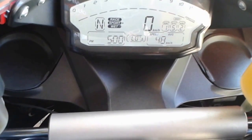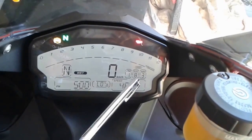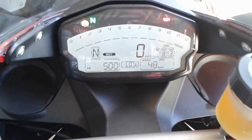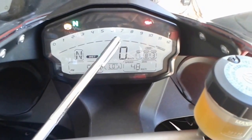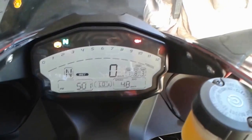We're using this button to select a different mode. Let's go into wet mode — hold that grey button in for a bit. Boom, it selects wet mode and the settings have changed. We've got EBC 1, traction control is way up at 8 — its maximum setting — and ABS is at maximum as well. That'll keep you safe in the rain and also cut down your overall horsepower. I've heard people say it's 100 horsepower or less in wet mode. The power delivery will be super subtle — just like riding a 250cc. It's fantastic.